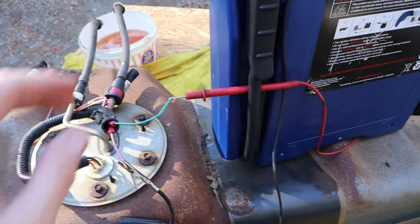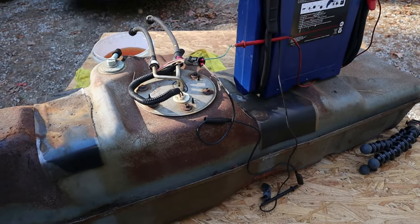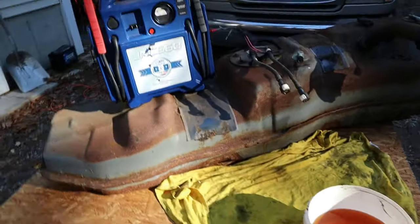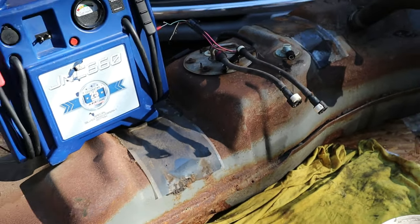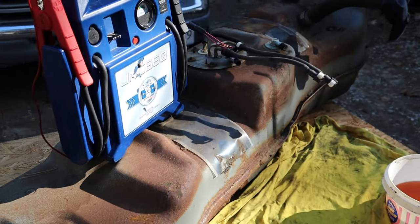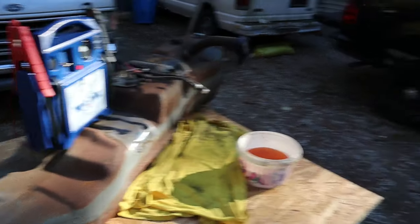Pull it off — don't want to fry the pump. I hope this video can help you guys out because if you do it the way I said and test this while it's still in the vehicle, you won't end up like me and realize your pump is good and you didn't even need to have the tank out. So test it in the car if you can, verify that your pump is good or bad, and that will point you wherever you need to go. Make sure to smash that like button, leave a comment if it helped, and I'll see you all in the next one.